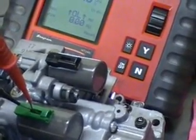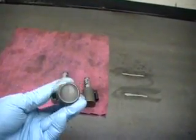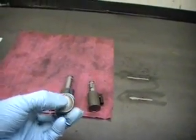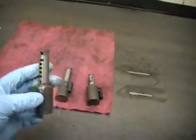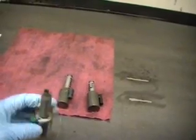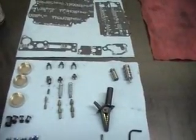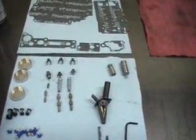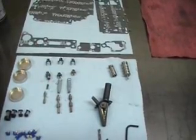They're all within range, so now let's cut them open. We're going to cut the back of the solenoid so we can take the cap off and remove the pintle from the armature. I already removed the valve and the spring. Here is our line-up: the first one is the lock-up and the other two are the two linears — SLU and SLS solenoid.